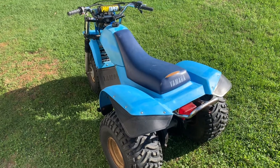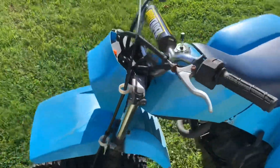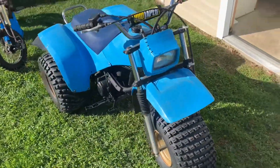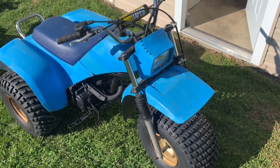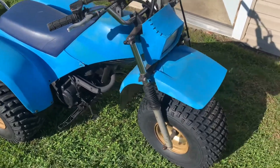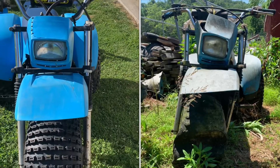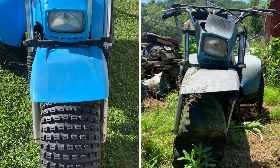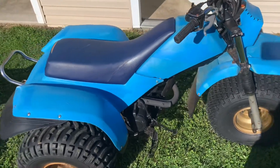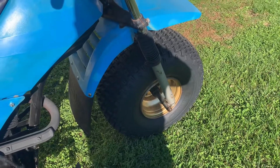What's up guys, thanks for checking out my channel. It's an old Yamaha YTM200 I got for 200 bucks. I'm gonna put some before pictures in — I should have had a before video and totally forgot. The thing was beat; it was sitting outside for about 10 years when I picked it up. It was wrecked, which is why it was left outside. The front forks were bent badly — I put them in a hydraulic press and straightened them out. The plastics were bent and cracked; I got them as good as I could, they were faded. I pressure washed and cleaned them up, used a heat gun to kind of bring them back. I needed a front tire — that was like 60 bucks at Tractor Supply.